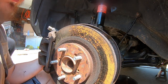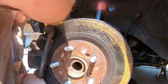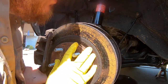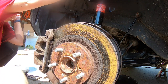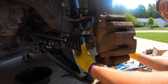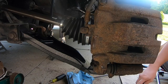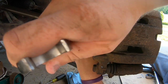This one does come with a new nut. We're going to start inserting it back in through the knuckle. You'll want to make sure you line up the threads properly, so have it back a little bit to where you can see them. Once the threads are lined up, you can start pushing this piece in. Go ahead and make sure the ball joint is in the little socket — it kind of just almost naturally fits in there. You may have to do a little bit of adjustment, then go ahead and put the castle nut on.